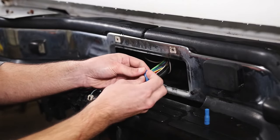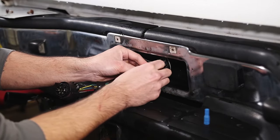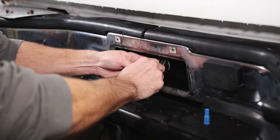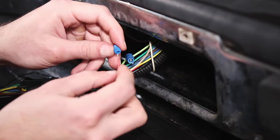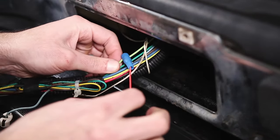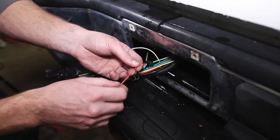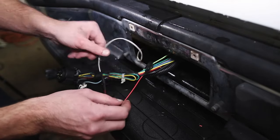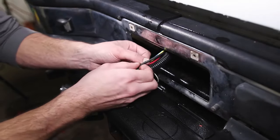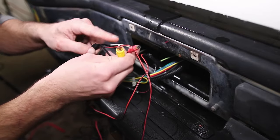So these are posi taps — they make it really convenient for adding electrical stuff to your vehicles. All you do is slide it around the wire and screw it on. We'll have a link to these in the description of this video. Make sure it's nice and tight, unscrew the top, take the red wire from the harness and just screw that in — as you can see it's nice and snug. So just as a recap, we took the green wire which is the reverse light for the trailer harness and we tapped the red wire into it using a posi tap. We also ran a white wire to the frame instead of using the black wire for the harness, because the posi taps weren't big enough to fit over this wire. Now we'll just need to run the rest of the wire to the front of the truck.